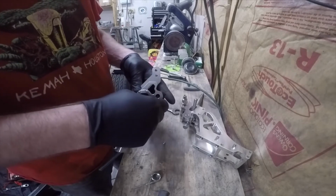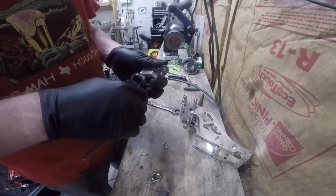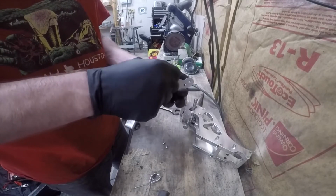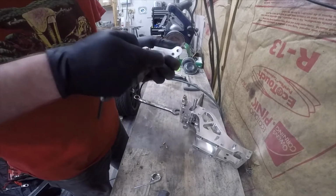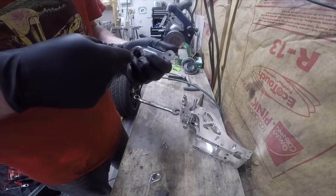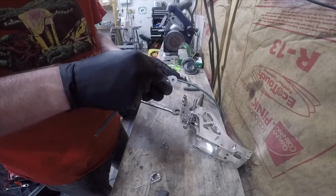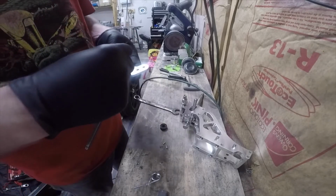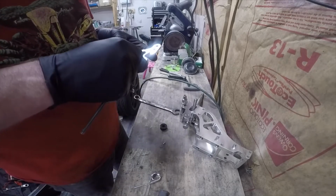I've also got some concerns about clearances if I powder coat this, so probably going to try and tape off surfaces that mate together but won't be visible, such as the surface right in there. Although it'll be a little difficult to tape off a perfect line, so I may tape off one side and not the other and see how the clearance comes out. Or, better yet, screw them back together before I powder coat it. And that way, powder doesn't get inside that sealing surface.